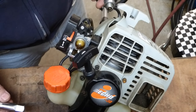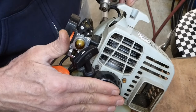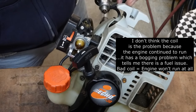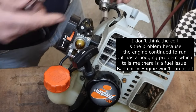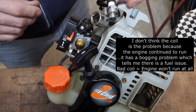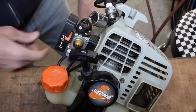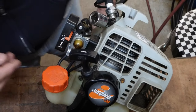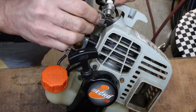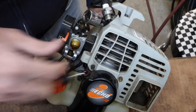While this is still warm, I took the spark plug out and we'll go ahead and check for spark. Sometimes when these get warm, the coil will quit, and that's a typical sign that they're starting to go bad. You have to touch the base of this to metal, so I'm going to put a socket extension in here for metal-to-metal contact. Make sure you turn the switch to on — the kill switch if you have one. There we go, we've got good spark.